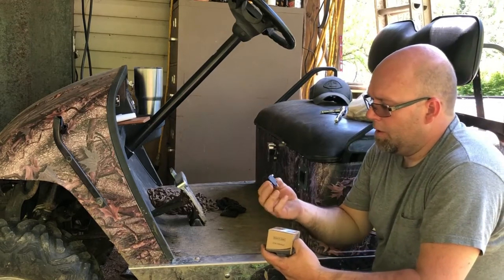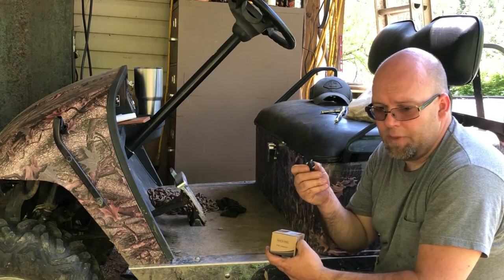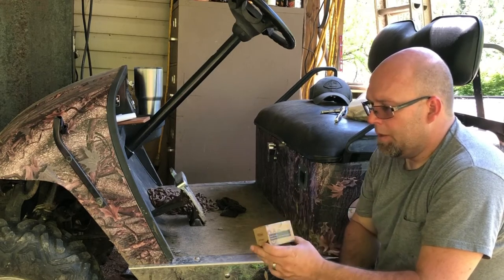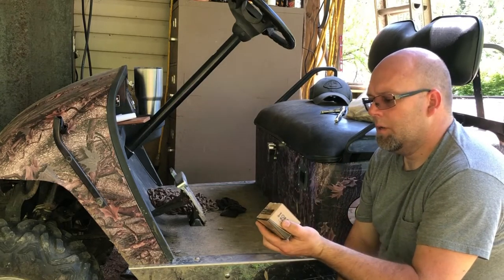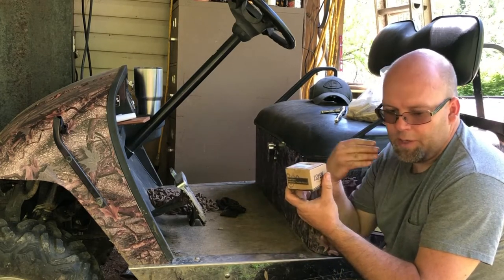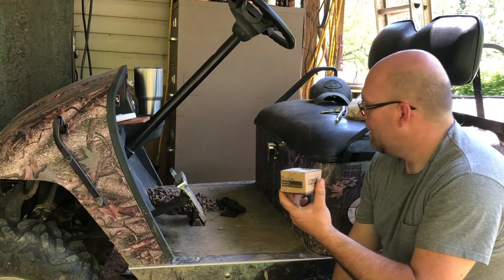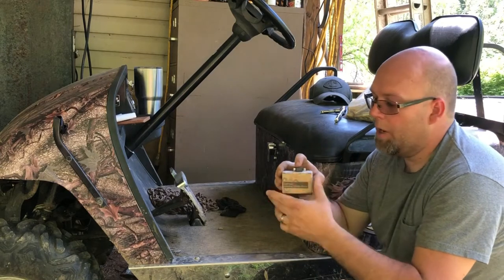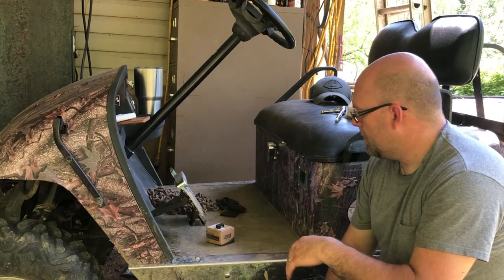So this is the micro switch we'll be replacing. I've looked at a lot of people who said this could be the issue. But while I'm in it I want to go ahead and do the throttle - the inductive throttle control - which just tells how much pedal you're giving, so it knows how much signal to send to the controller to tell it what to do to the motor. So these are the only two parts left to my knowledge.